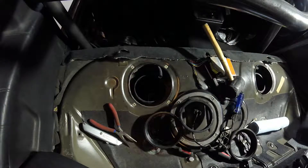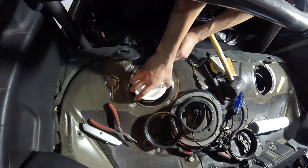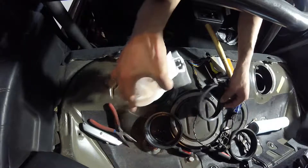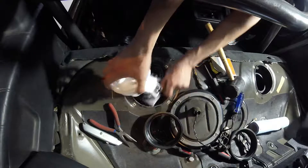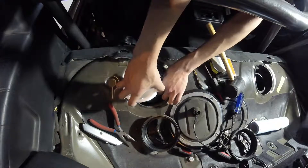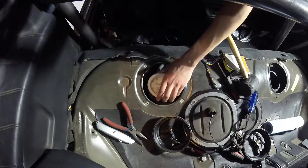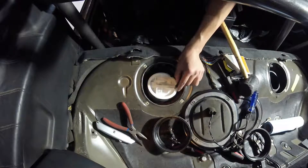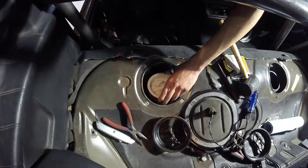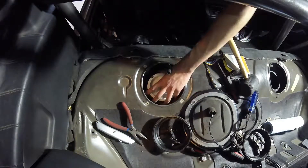We're back and it's time to install the new fuel pump. Go ahead, stick the float device down in there. The O-ring came out on this side, so we need to reinstall that first. Just make sure this O-ring goes in there nicely — it sits on the inside of the hole. Because a pump doesn't normally go on this side, if you try to install it in the same orientation as the one you just removed, it won't go in — remember the electrical connectors are over there. What you need to do is put light pressure down and then rotate it counterclockwise until it sits down in there. You'll notice it's way down and fitting perfectly now.